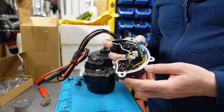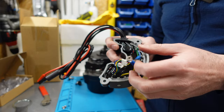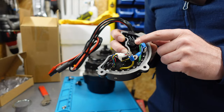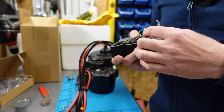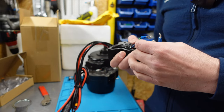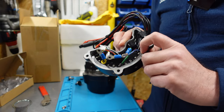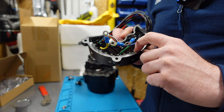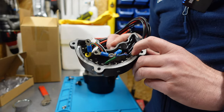I was very interested in how the controller looks — here it is. As you can see, it's fully potted. Here are the phase wires; they are fairly thin, unfortunately, but we'll see how this affects the motor. It comes with only one capacitor, which is not a great indication of torque performance. But we'll see how it delivers. The motor body is bulky, similar to the BBS HD. The screws on the perimeter of the housing attach this heat-conducting metal plate, and you have MOSFETs bolted to it.